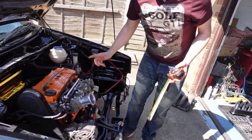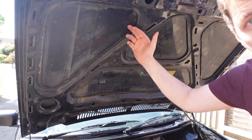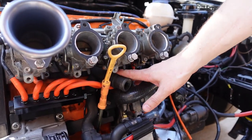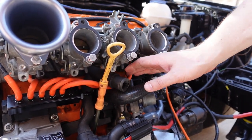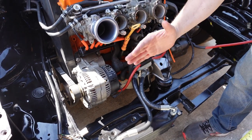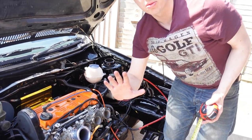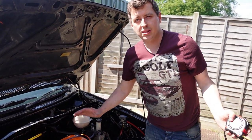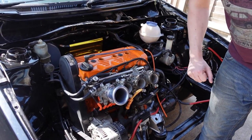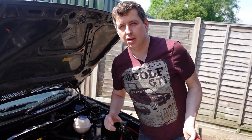And at this point already, we're in a conflict zone between hitting the bonnet. If we angle it lower, we're getting close to this ABF coolant flange here, which is already aimed further down than a KR, I believe. And then we're also into the realm of where a factory radiator would be and a VW cooling fan without going to a slimline. So you see, we need a better setup. Otherwise we're going to shorten this and lose torque. And if we're going to all this trouble, why would we want less torque than the factory single throttle intake setup?